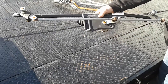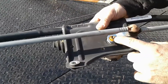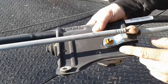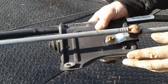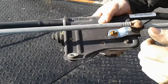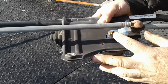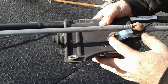The only modification that might have to be done, depending on what vehicle you have, is this little wiper arm. Some of them have round holes; some motors have round shafts and some motors have square shafts. If you have the linkage with the round hole and the motor with the square shaft, you want the square shaft when bolted on to be straight across. For the round hole, I just take a whizzer tool with a carbide cutter, put it in the hole and tap it a little to each side — very little. Then you push it down so it'll be snug onto the motor.